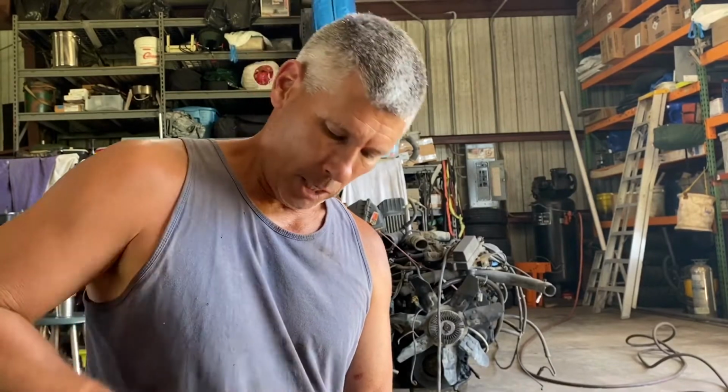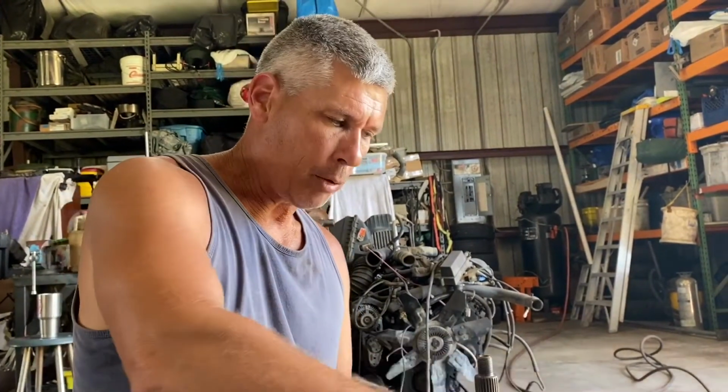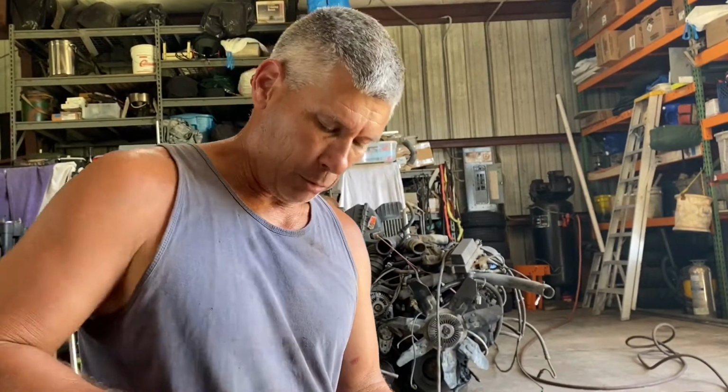So once you put this in there, and that's with no seal in the housing, you put all this together, you put the yoke on it, and you torque it down, and once it's torqued to spec, it's shoved down against the shim stack. You get a little inch-pounds torque wrench, and you rotate this, I always just go clockwise. It needs to take 20 inch-pounds to rotate that pinion, okay? But most people don't do that. That's kind of important because as bearings wear, it's gonna get loose. And these bearings are the ones that take most of the abuse. The side bearings almost never go bad, but the pinion bearings are the ones that take the abuse. So that's what the shim stack is for.